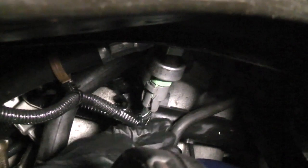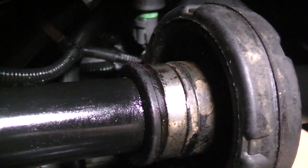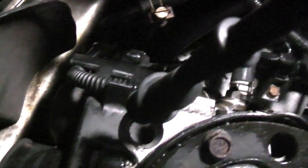I'm going to reinsert it to the switch. Now hook up your meter leads. I'm going to take my red lead from my meter and clip it to the end of that T-pin, and then my other lead and clip it to the block. The block is a piece of clean unpainted metal that will provide us with a good ground. Make sure your meter lead has good contact — that means avoiding rusty or corroded metal.